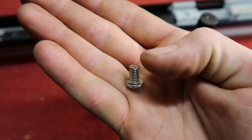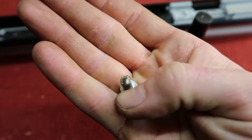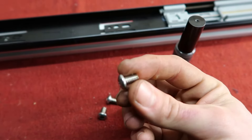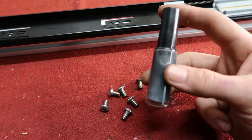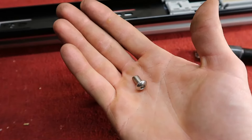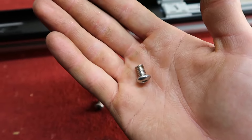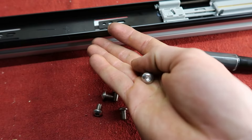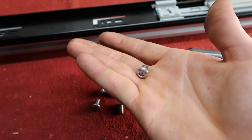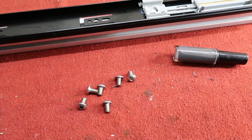I actually had to take the grinder and shorten them just a tad. I did that by threading a nut all the way on, then threading the nut back off to clean up the threads so you can install it. Another step — we're not going to use Loctite; instead we're going to use fingernail polish. This is a trick that carries over from gunsmithing — a lot of people use it on scopes. It's just like Loctite, but if you ever have to unscrew it, it's not going to be completely stuck, which is important when you're dealing with Allen screws since they're prone to stripping. I do recommend using fingernail polish on any screws you don't want riding loose throughout this project.